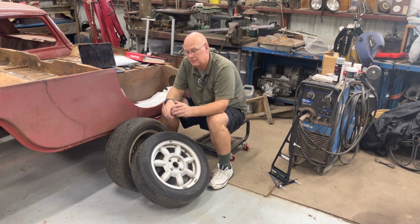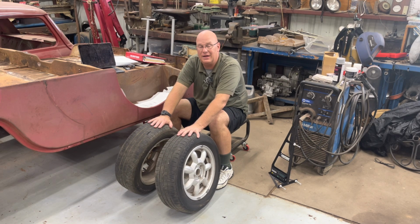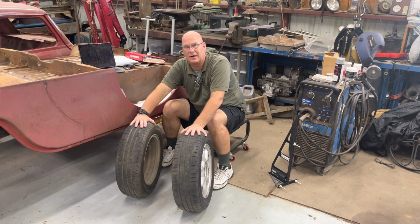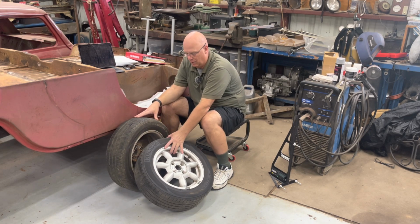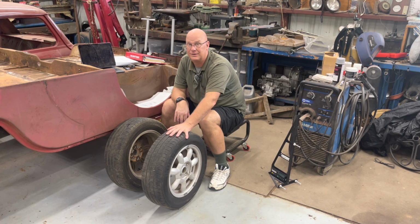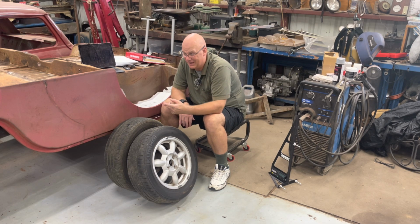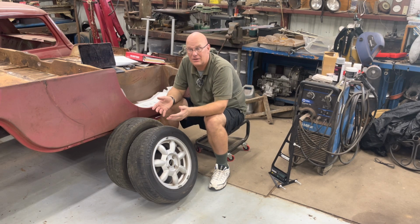That's called understeer. Well, to get rid of understeer, you add more camber. You tilt the front tires in more and more, so when you turn, the tire gets all the tread on the ground. You want negative camber for better turn-in. What most car companies do, take the Porsche. They say 0.25 degree leaned in at the front, which isn't very much at all. But the rears are 1.5 degrees, and the big tires are on the back. Porsche wants the back end to stick no matter what, and the front they just skid. They don't get sued that way.